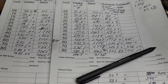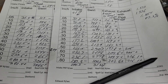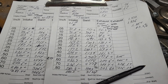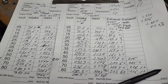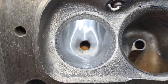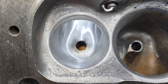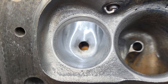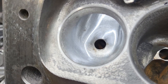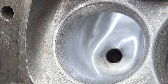I have no idea where to go next — no air speeds. I wanted to show you the new and improved exhaust port. Let me get some light on that. I did make the throat a little bigger — we calculated it last time, it's like 87 percent instead of 85. The sides of the bowl got kicked out a little bit and the radius from the seat down was changed a little bit.